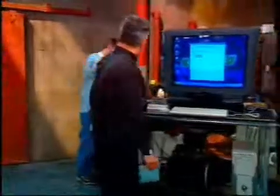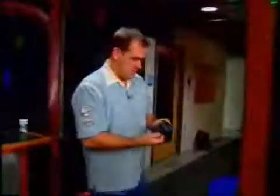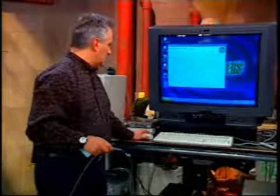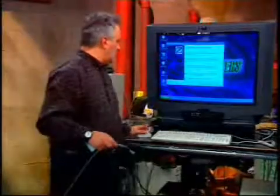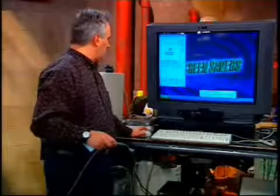He's getting angry now. We're going to try another one. Unplug it and let me plug it in again down here. If these are passive connections — basically plugging one USB into another USB — you can use devices that are active. They're basically repeaters that boost the signal. It found the USB camera. But does it see it? No, it doesn't. I think we may be having some problems because of the length. Five meters is the limit.